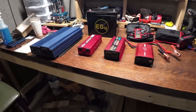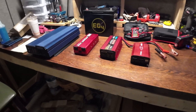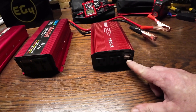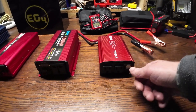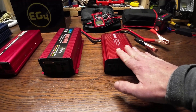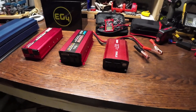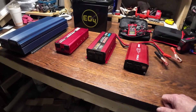That's an expensive unit designed for that type of efficiency. These budget units — you turn the power switch on and it runs, that's it. If the fan runs constantly, that draws power; any lights or components inside always draw power. I like these small ones because the USB ports are pass-throughs — even without turning the unit on, you can plug in a USB device and charge from it. Other units require the system to be on to use the USB ports.